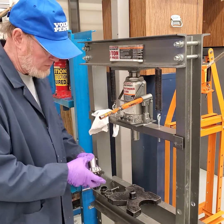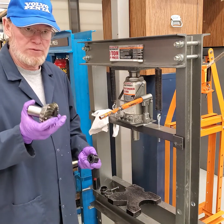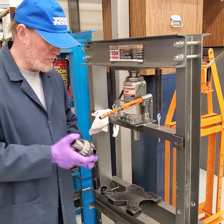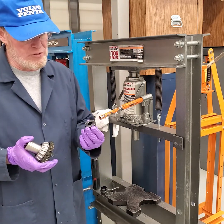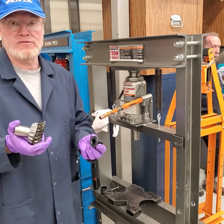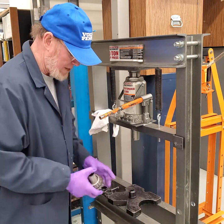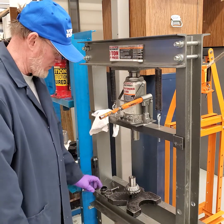In the book, it really doesn't go over — with the DPS XXM drive on some of the newer models — how to protect the gear when putting it on a press. In the older manuals there is a tool, 884259, which you'll probably have in your toolset. It fits into this gear perfectly, so I can put this on a press, put the gear on that tool, and it supports the gear off the press.